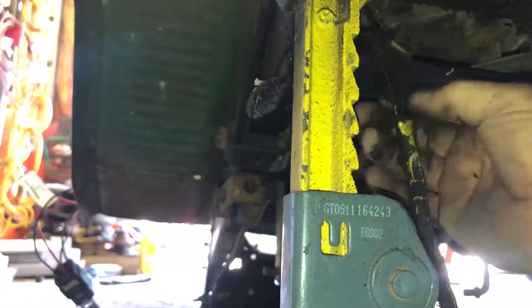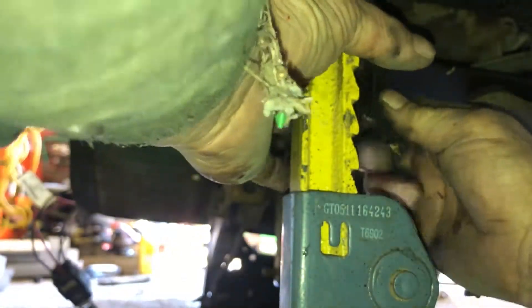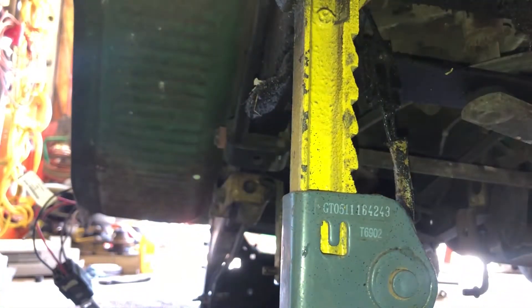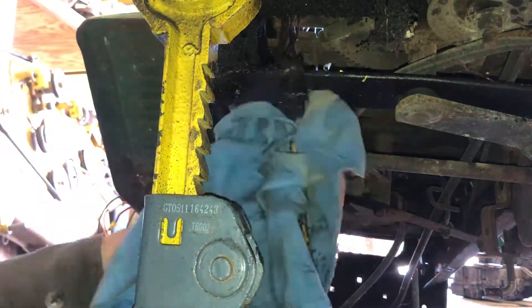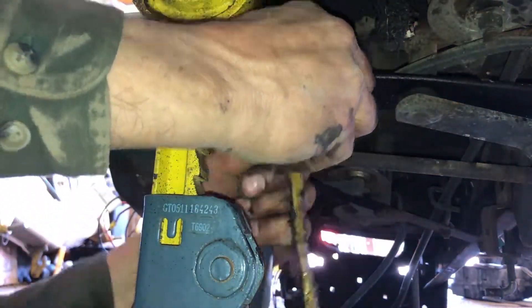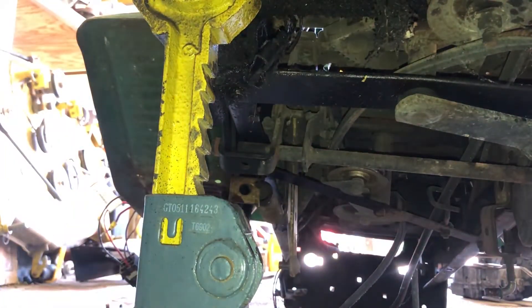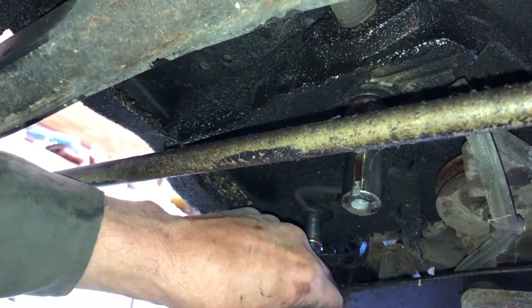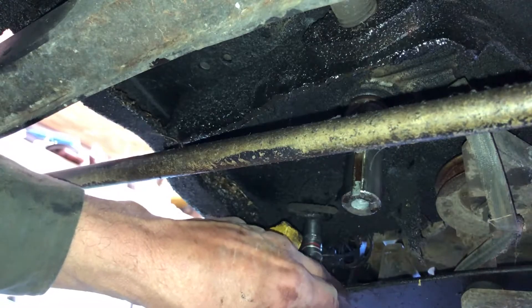Now you've got a wire you've got to pull through and disconnect the one that's attached to the clutch pulley, so you can get that out of the way. You can take a little screwdriver and stick it in there to open that plastic up a little bit — makes it a little easier. There's a little bracket I'm taking off out of the way here also. It's all half inch underneath there except for the clutch pulley.